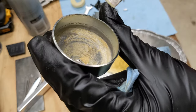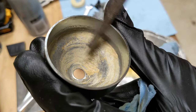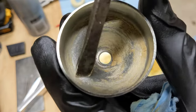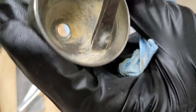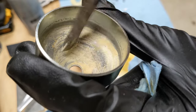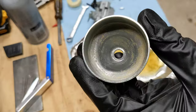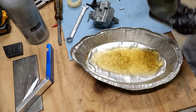I'm working on cleaning up the bowl. You can see that whitish powder down there — that's what ethanol fuel leaves behind after it evaporates. The residue is this kind of white powdery stuff and it's really hard to get out of your carb bowl, almost like a corrosion. It won't be perfect, but it'll be good enough. No big chunks or anything like that.